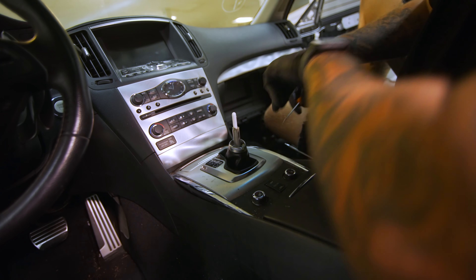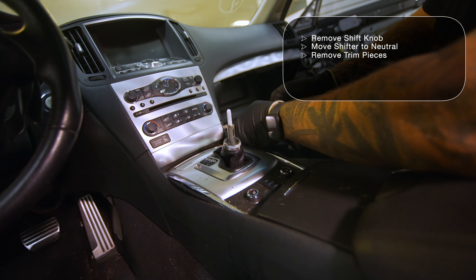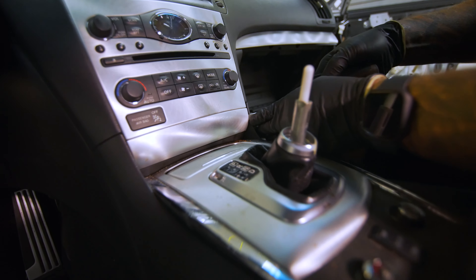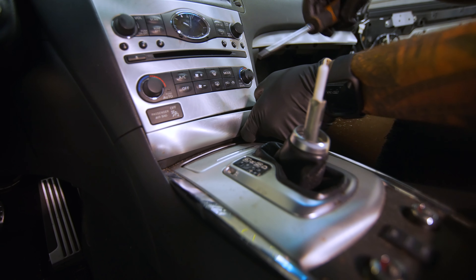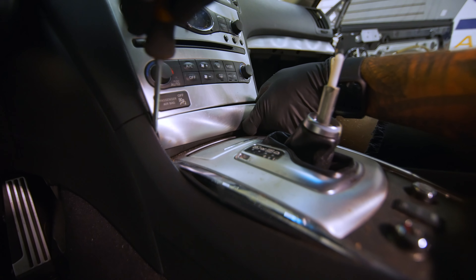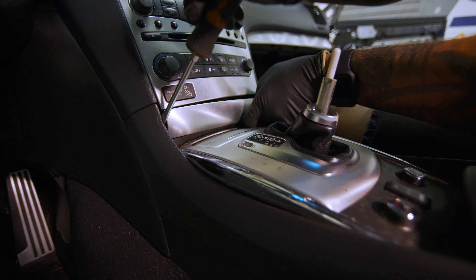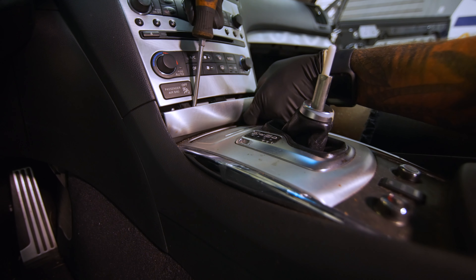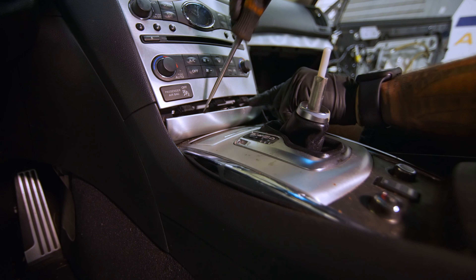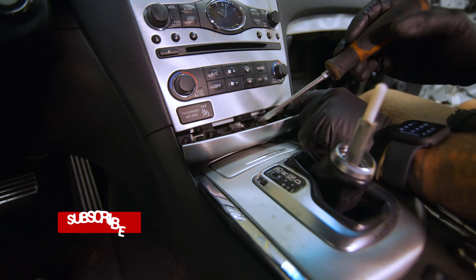Pull your pick back out of there. Then we're going to come up here, go in through the side of that plastic, just give it a little twist to get out. Same thing on this side — go in right there. Give it a little twist so you don't damage the dash. And then go like that. That's going to expose these bottom clips right here, and you'll see them pop out.